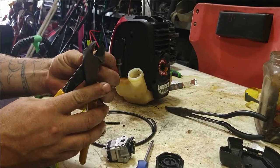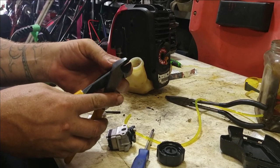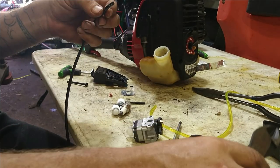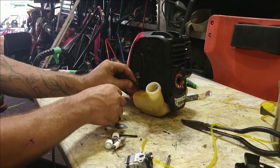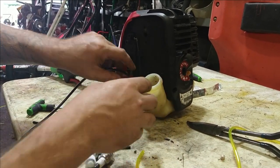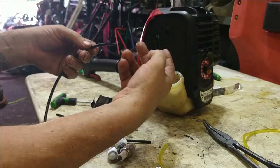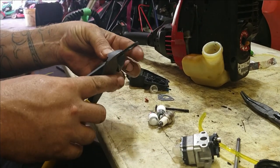We're going to cut this fuel line into a point. We'll use the black fuel line — the black fuel line will last a little longer. Cut it into a point and make the point a bit long if you can. Then we're going to stick it in the furthest hole from the mouth. Just get it pushed down in there, then reach in — I use a long pair of needle nose — and try to grab it. This is going to be a little difficult because of the angle; we're going to have to cut this back a decent amount where we've got enough room to grab it.